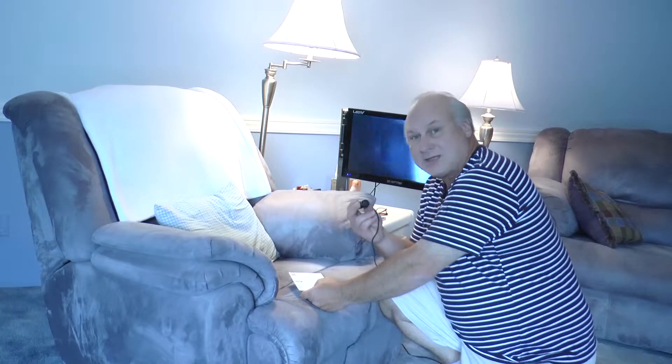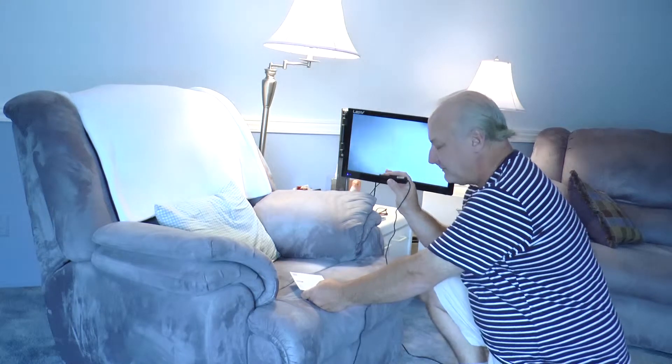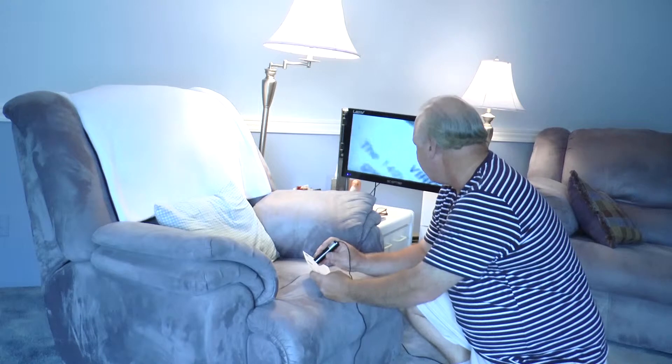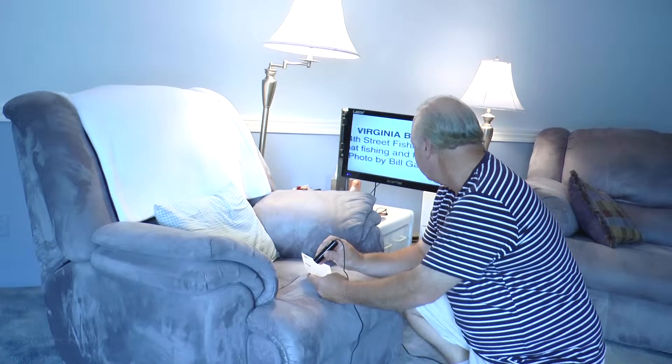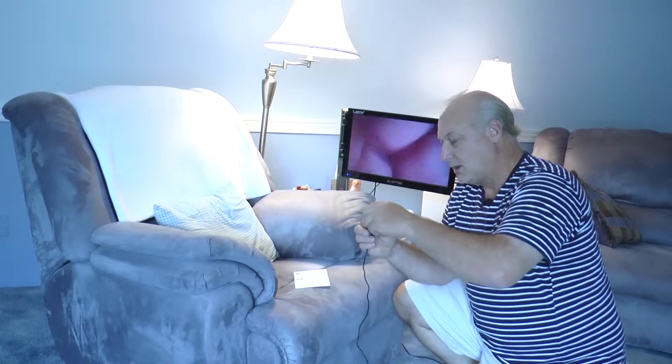One other thing we've done: I have a bullet camera and I've connected it to the video input on the TV as well. This is a postcard and at the very top is some really small lettering, and if you take the bullet camera and position it over top, you can now read what it says. You can also do this with prescription bottles, pictures, anything — you can even put your hand under it. You want to get one that has at least 420 lines of resolution. If you get a 380-line resolution camera it's not going to be clear — you'll get a lot of grain and it will be dark. So no less than 420 lines of resolution.